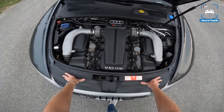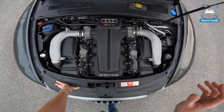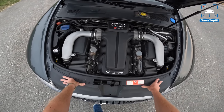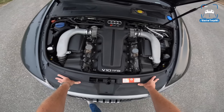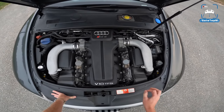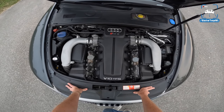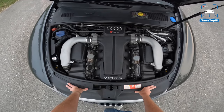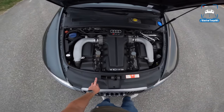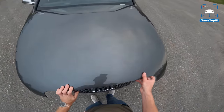The beating heart of this RS6 is a 5-litre V10 with two turbos. Even though Audi already had the S6 and S8 with the 5.2-litre naturally aspirated V10, the base of this engine is actually the 5-litre from the Lamborghini Gallardo with two turbos mounted to it. Stock it produces 580 horsepower and 650 Newton meters of torque, but this car has more power — a custom exhaust and an ECU tune by Perform Enhanced bringing it to 780 horsepower and 955 Newton meters of torque. That engine sits ahead of the front axle, which is why the nose feels very heavy compared to later RS6 models. It also has Wagner intercoolers as an upgrade.